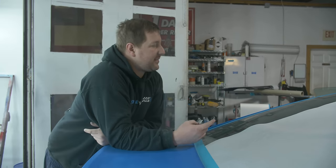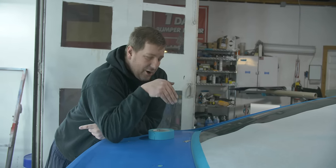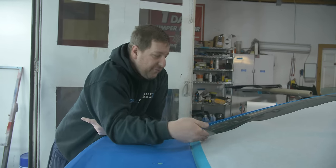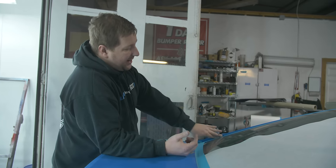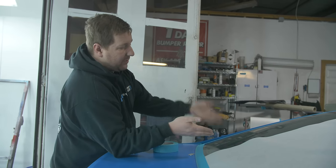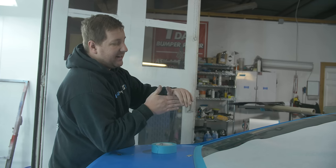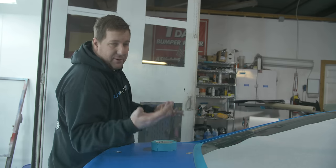Now the front glass, we're actually going to use a 3M trim lift tape to go between the gasket and the paint, and then we're going to pull it away from the panel so that we can paint behind the rubbers. Once we remove that tape, that gasket can go sit over top of where we painted. And that way it can be a protected edge.